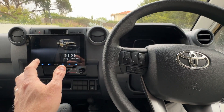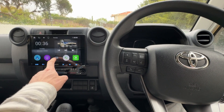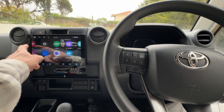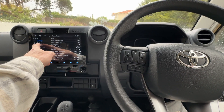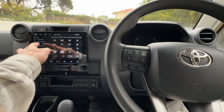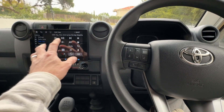This is the new 70 Series kit, but the programming is the same for all vehicles. Go to the home screen, slide on over into the Settings — the screen's super responsive so it's really quick and easy. Go to Steering Wheel Control Keys, SWC Key, and it's going to come up with all the functions that you can do from the stereo.